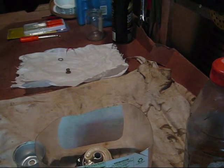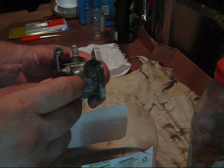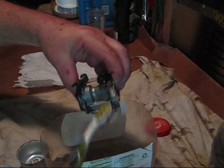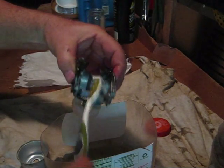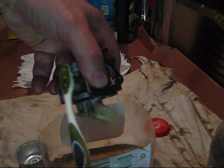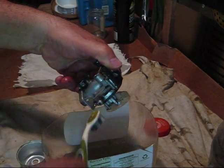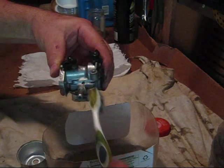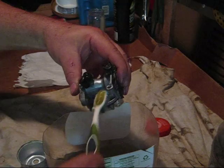I'm back and I'm working on this carburetor inside just to make sure I don't lose any of these pieces. I'm going to clean this — even though the outside has nothing to do with it running, you want to keep it clean. When you put it back together you don't want any of this debris to fall into the carburetor that you just cleaned out. It only takes a couple of seconds. I use a toothbrush, I use a paintbrush — whatever happens to work. In this case the toothbrush is getting into where I have to go. Normally I blow these out before I take them apart; that's when I got a little bit ahead of myself.